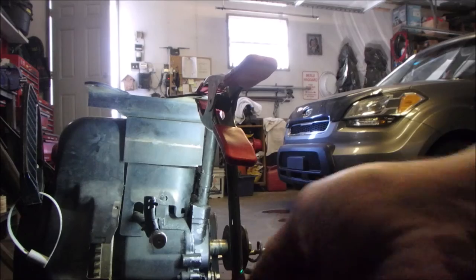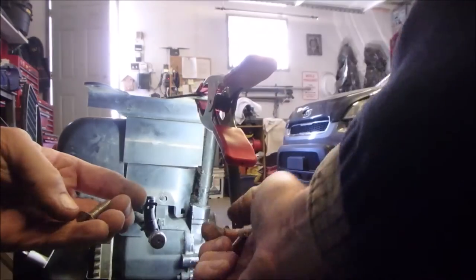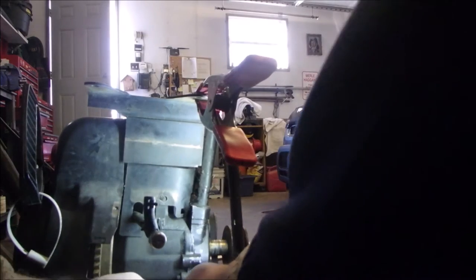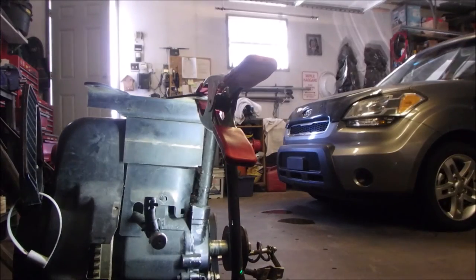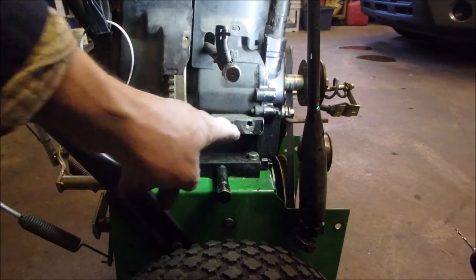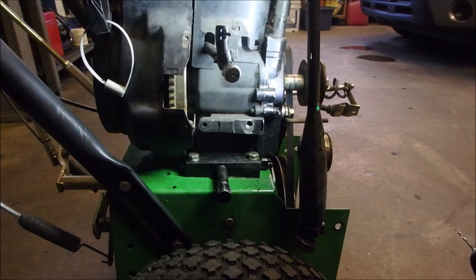This one is a quarter inch. We can use him all day long. But up here, that guy's also been pulled out. So have they been tapped to 5/16? No. So I think we can do that. So now I'm going to tap that to 5/16, tap that to 5/16. We'll drill them both according to the size for a 5/16 bolt. And maybe we can still mount that